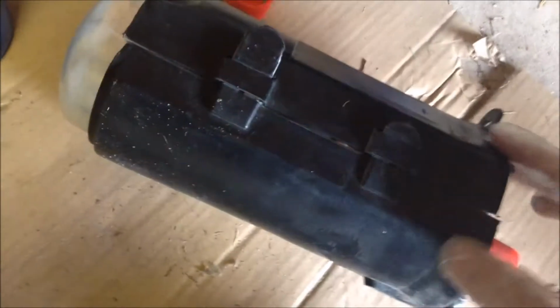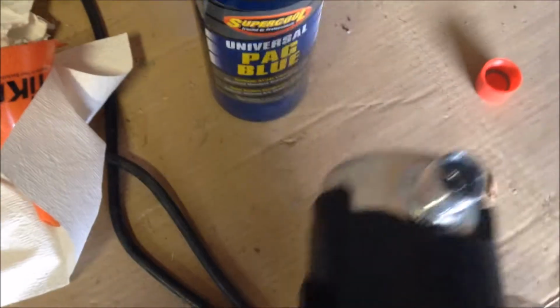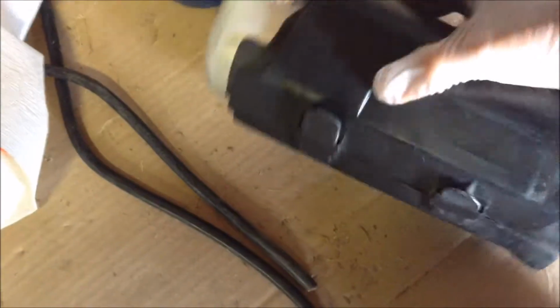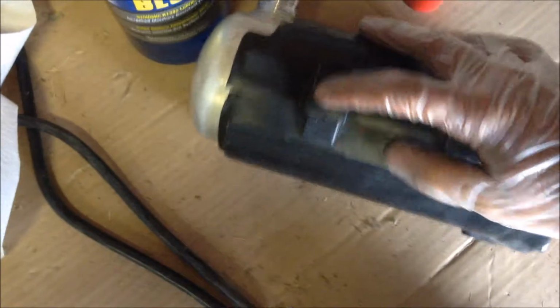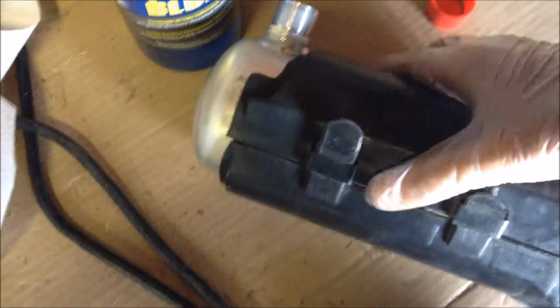Basically you have this little sleeve. There's a little bolt right here at the bottom. If you're looking at the fender, it sits like this. If you're looking inside the car, you have a port on the bottom, a port on the side. So basically, once you pull this out, pretend this is the old one, you'll take a little screwdriver, pry this up, this pops out, pry that up, pop that up, and that's basically it. There's a little hinge here, it opens up, and take the new one, slap this on, good to go.